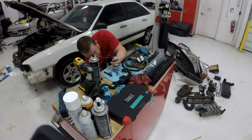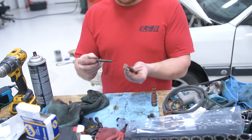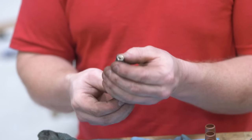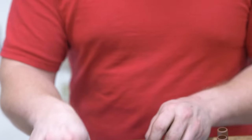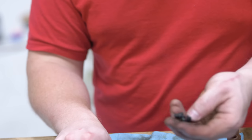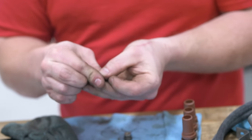Cleaning these injectors, and basically this cap is just pressed onto here, and that just kind of protects the end of it and gives you a cone for the spray pattern. But you have to take this off to get the O-ring that's on here, these guys, which are actually so brittle and old that most of them are coming off in just pieces, and they're super hard. You can just crack them in half,